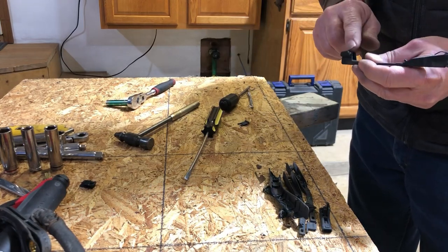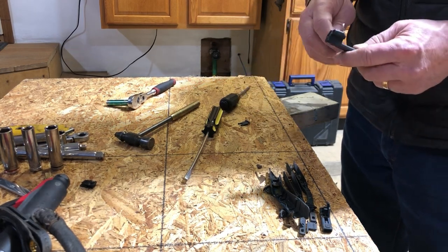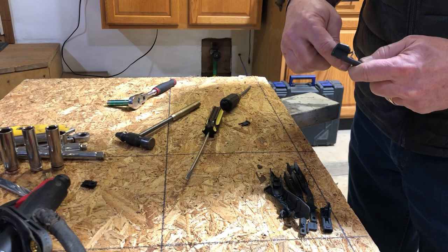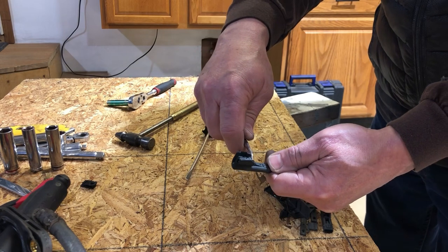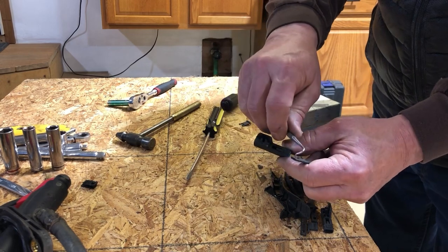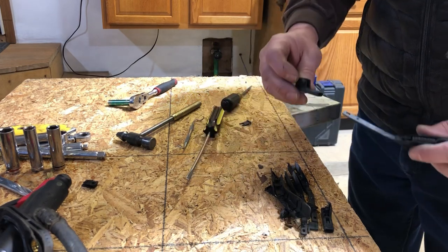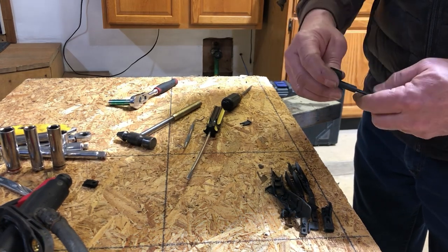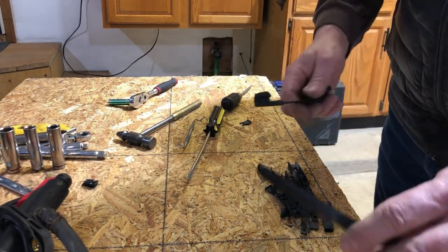The little nozzle is broken off here. Normally I would replace that, except I've run out of this angle assembly. But to replace it, you've got to reach in that little pocket right there and kind of push it with your thumb, because that little plastic thing is a detent that goes in that hole. Then you put another one back on. I don't have an unbroken one; however, this one will still hold because it's got both sides and the clip in it — it will still hold a wiper blade. So I'm going to reuse that for this demonstration.